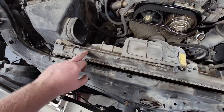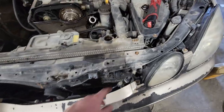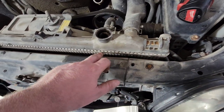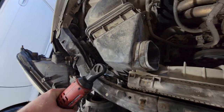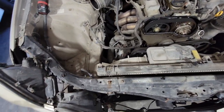These grommets sit on the feet so the radiator is completely encompassed in rubber so there's no shock that will break it. Typically all of these are plastic and they do crack — actually for the most part they don't even break there, they separate between the metal and the plastic. Make sure you keep an eye out for that. It's probably a good idea to just go ahead and take this box off so you're not fighting the radiator trying to get it out. With the box out of the way you get sufficient room to work on stuff at the bottom.